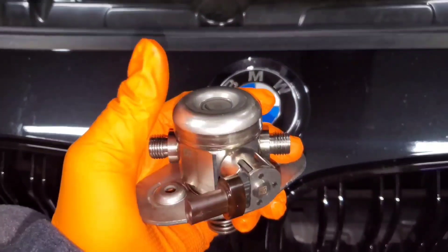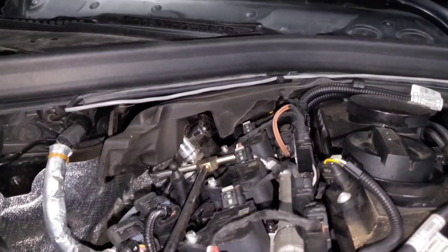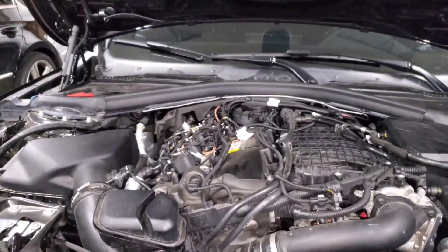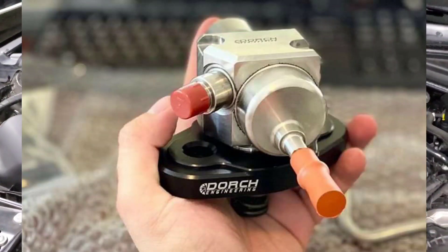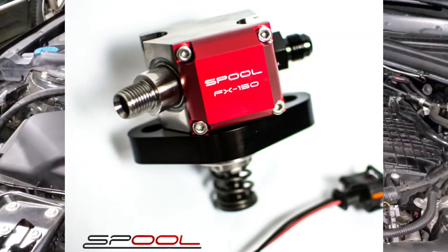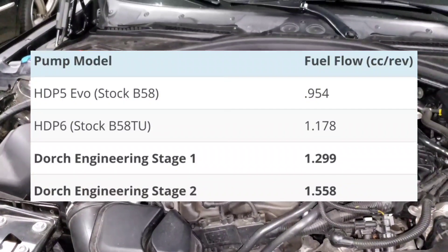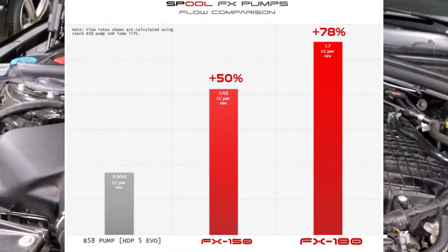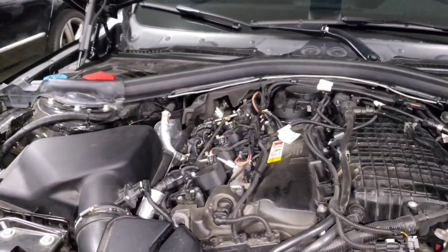Off-the-shelf maps are for E30 for Stage 2 — that works with the stock fuel pump. The next upgrade is the TU pump, which flows a lot more than stock. Then you also have the Dorch Stage 1 and Stage 2, as well as the Spool FX-150 and FX-180. Majority of people recommend the Dorch pump — it came out a little earlier, has great customer service, and strong reviews. The Spool pumps are a little newer and more expensive, but the FX-180 does flow more than the Dorch Stage 2. It comes with a lifetime warranty but requires their specific filter, and there have been some issues with that filter leaking, so people typically recommend the Dorch as it seems bulletproof.